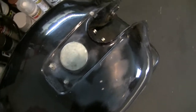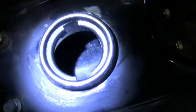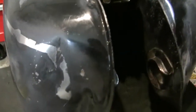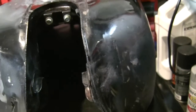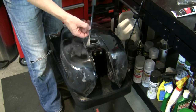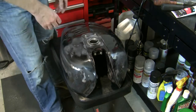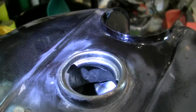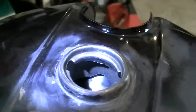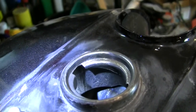Overall, this tank is in pretty good shape. It's rust-free on the inside, which is nice, but we've got a good crease in here and a good crease in here. You could put tape on this to blunt it so it doesn't have these sharp edges, and you could run it into the tank and just press those things out if you can reach. But there's a problem with this particular tank — they have this lip right here of metal. It keeps the fuel from splashing when you're filling the gas tank, but it's also going to keep me from running any kind of tool up under those dents.